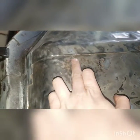So we're gonna get a little less crazy. Like this is just bare metal. No galvanizing, no coating, no paint, no anything. And I think that is more risky than this, because this has galvanizing on it or whatever this coating is on the steel. This is going to be bare steel, so the minute that touches water and oxygen, it's going to rust. The galvanizing adds some resistance to that. So I think leaving it like this right here is going to be better off.